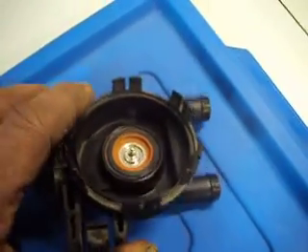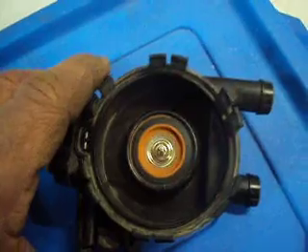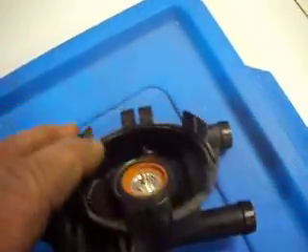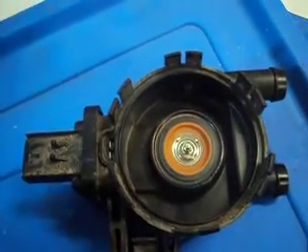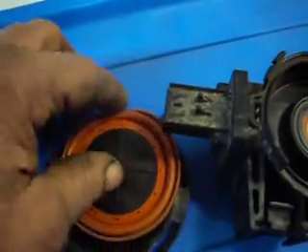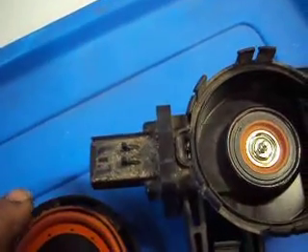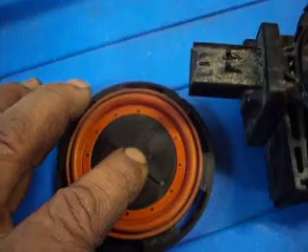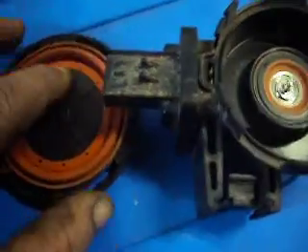Just a brief explanation of the solenoid assembly. Normally, as the NVLD sits, the system is closed to the atmosphere. So what happens after you shut your car off, the fuel in the tank supposedly will cool, and as it cools it contracts, and that contraction will draw this diaphragm here. Underneath this diaphragm there is a micro switch, and as the vacuum in the tank increases, this diaphragm will push on the switch, and that closes the contacts. That will drop the voltage to zero so the PCM can read zero voltage and know that the switch has closed.